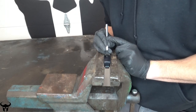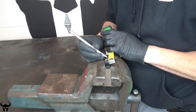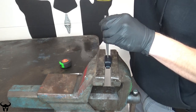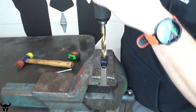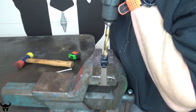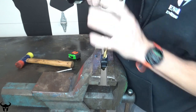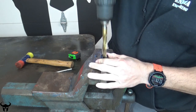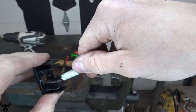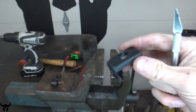It's hard to find the center on these — I'm estimating with an X-Acto knife, and for the length I'm using the tape measure. Punching the center hole. This is a half inch bit. Clean up some of the burrs with a blade. Test fit the switch.